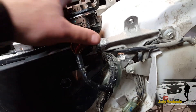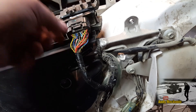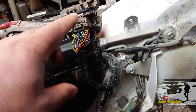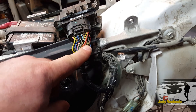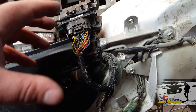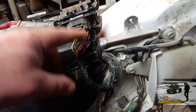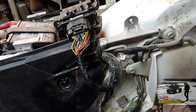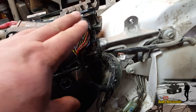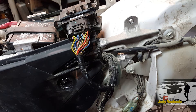So we've got the ECU of the bike - I've moved it up onto the top of the frame because it's just so much easier to get to all the wires. You're far better off testing from the ECU end, because if the signal's wrong at this point, then it's testing the wiring harness and the sensor at the same time. So if the signal's bad, you can go back down to the sensor and take the same waveform again from the actual injector.